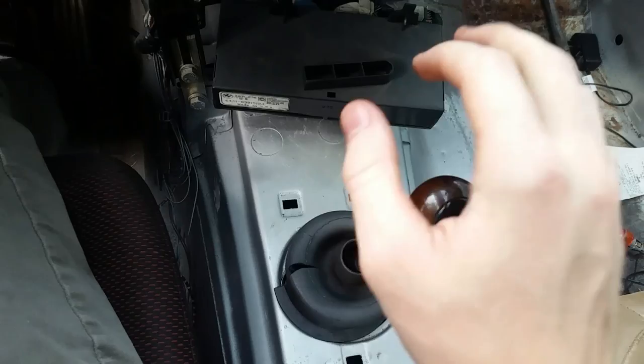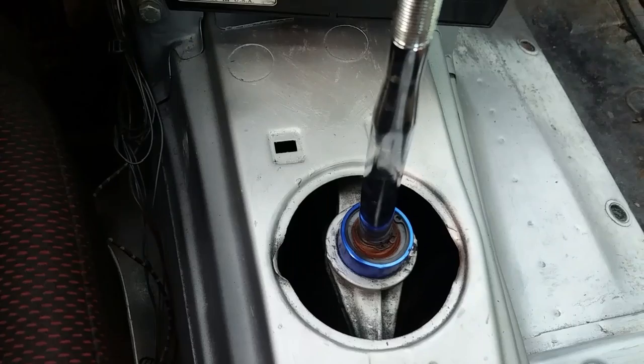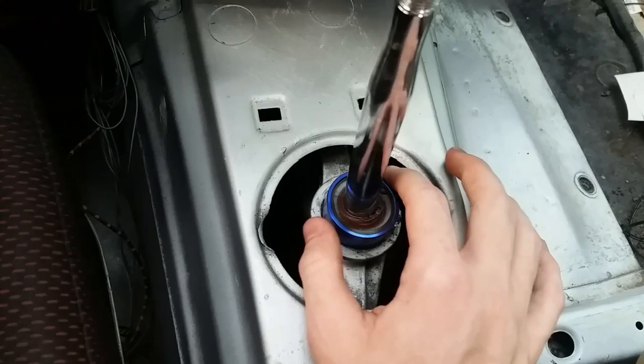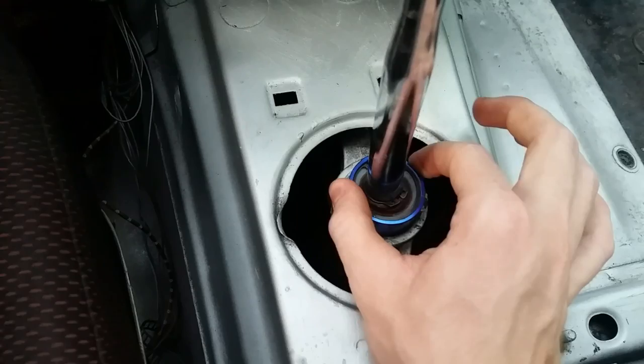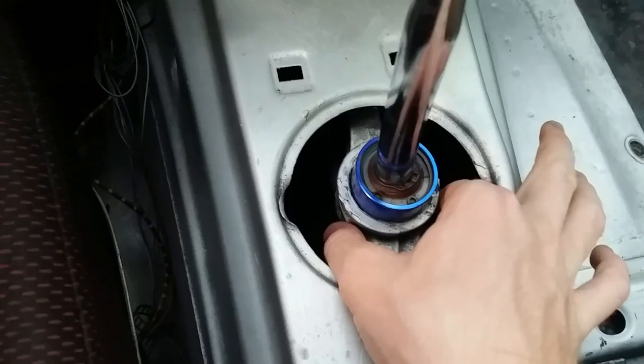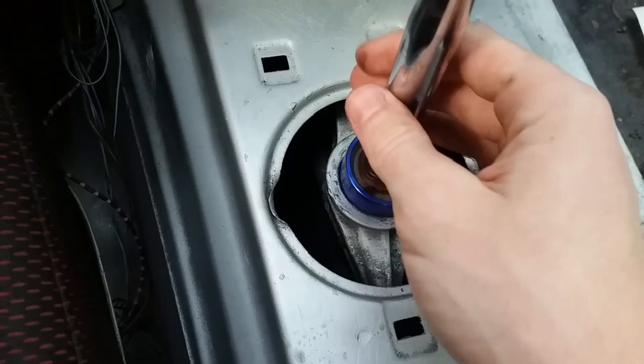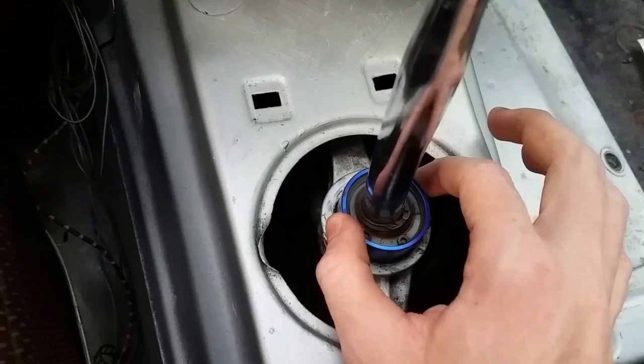A lot of you are wondering about installation and whether you can do it from the top of the car without going under it — it is doable, but I highly recommend putting the car on jacks and going under it; it's much easier. The simple overview is there's a bushing on the stock shifter that you twist to undo. Once you undo it, you pull it out. Before that, you have to undo a clip on a selector rod underneath — there's a connector rod, and you undo the clip on that side, then pry it out. After that the whole thing comes out. Once the stock shifter is removed, replace it with the short shifter, reconnect the selector rod, and put on the circlip at the bottom to keep it from wobbling. Then you're done.